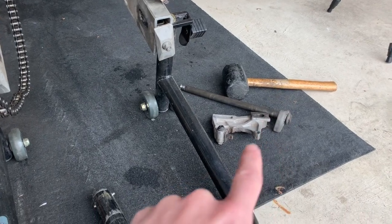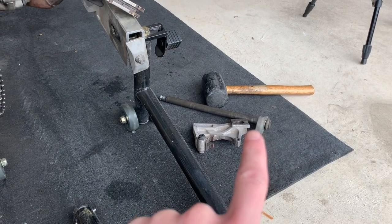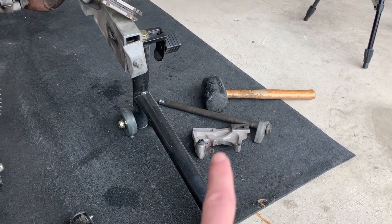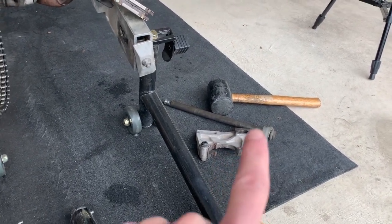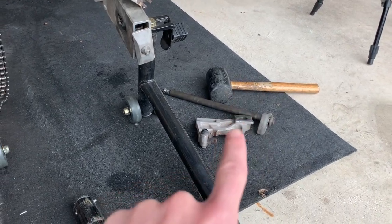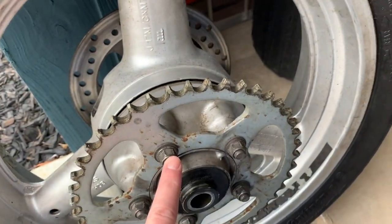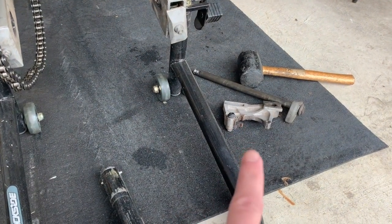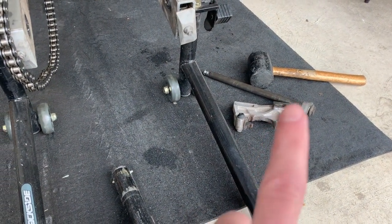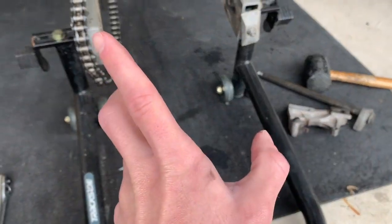When you go to put the GSX-R rear wheel on this, I'll put the details in the link below, including what years of GSX-R you need. This brake caliper bracket needs to be sent off with the sprocket carrier from the GSX-R wheel. You've got to send them off to TWF to be machined — they take a little bit of clearance off of those for the wheel to fit in here.